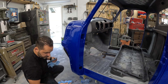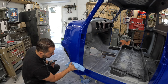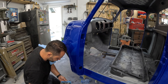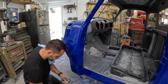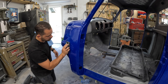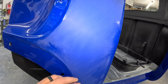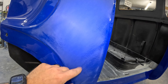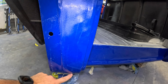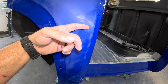I'm cleaning up the panel a little bit so we're not grinding dust into it with a new microfiber cloth. They do say squeegee it, but I don't have a squeegee — poorly prepared for this. Now 1500 on a little soft block, just see what happens. After going over it a couple times it actually flattened all the way out. So the 1500 is doing great. Just a little bit of orange peel to get out and I'm going to bring it all the way down to here so it's really uniform throughout the panel.